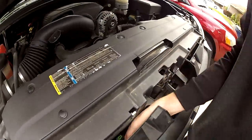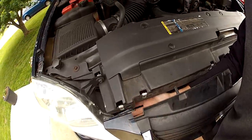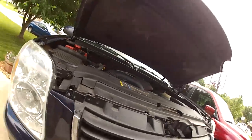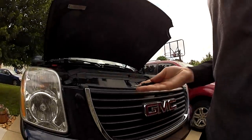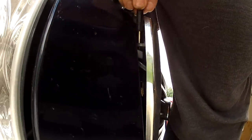The first one you want to go for is over here on the side. That's how I had to put my arm in to get down to the first clip. Take a really small screwdriver in hand when you're reaching behind the grill, find the clip with your finger, and then find the back part of the tab right there — that's where you're going to push.